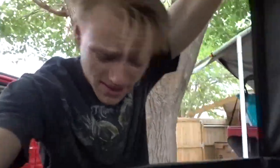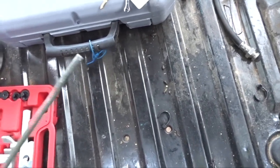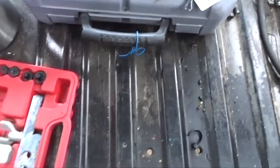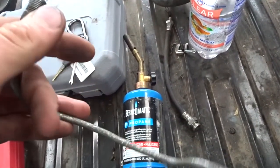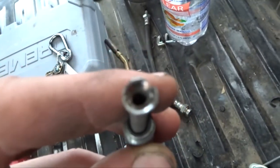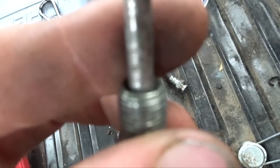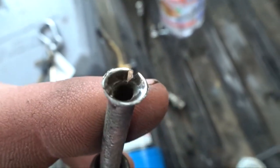Hello and welcome to another day — it is July 5th! I got the brake flaring tool from AutoZone. I'm gonna go ahead and start flaring these lines and bending the brake lines so it'll all be hunky-dory. So I got a brake line done — the end was already flared — and then I tried to flare this other end which I'm gonna have to redo because it cracked right there.